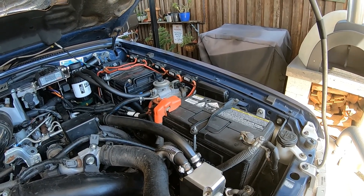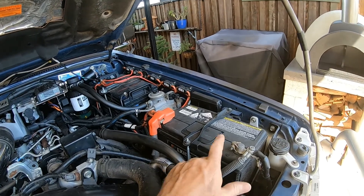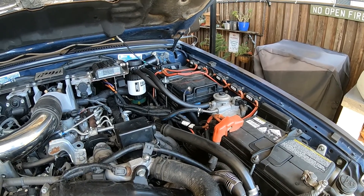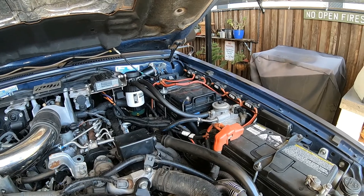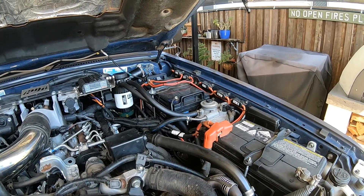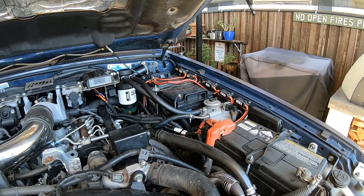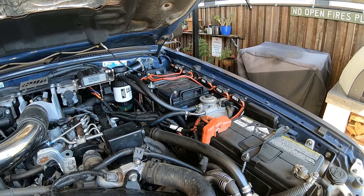Jamie's Touring Solutions tried to convince me not to run the winch off the main battery. I'm having second thoughts about that, and I'm wondering whether I can run the two batteries in parallel to run the winch, and also just in case the main battery goes flat so I can draw on the auxiliary battery — another project for a future stage. The lead crystal battery — well, that's the second one in this vehicle. The first one got cooked. Jamie did tell me you shouldn't stick it in the engine bay, but I was stubborn and stuck one in. I was at Adelaide last year and it just wasn't holding charge — I was running two fridges in the canopy off it as well. So I nicked the battery out of the camper and stuck it in here. I've since replaced the batteries in the camper with lithium ones, so I've got a spare lead crystal. The original lead crystal from this vehicle has been taken to the battery recycler.